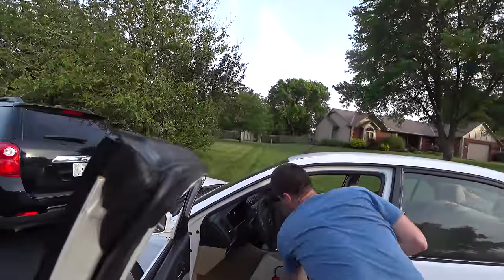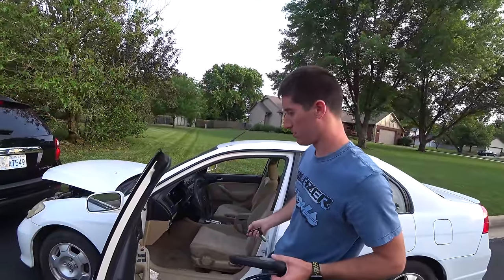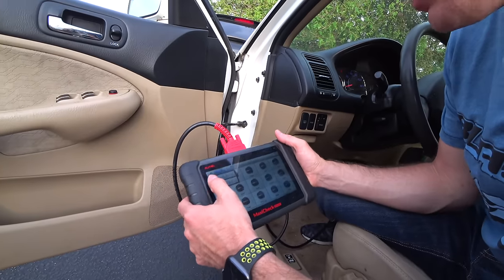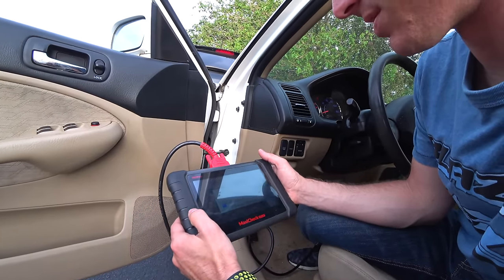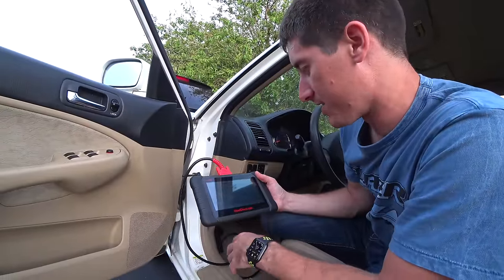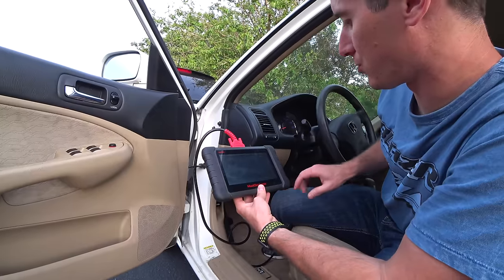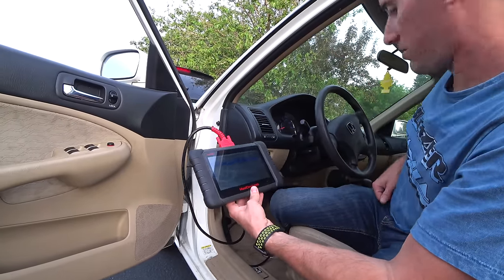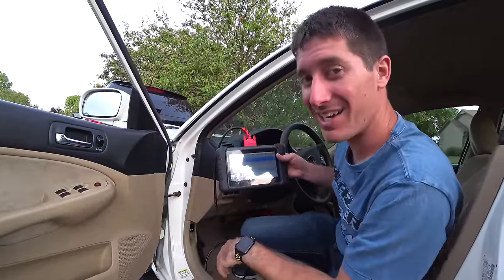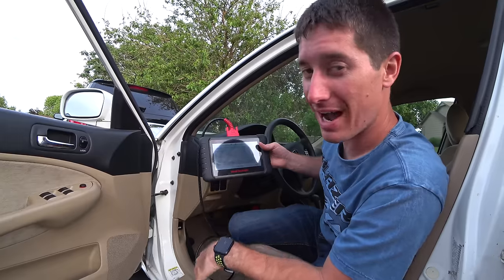Got some keys. Came with a quick trip card and a bottle opener and a remote that may or may not work. It appears it may not. See if auto VIN scan will get it done so I don't have to do any work. This is a 04, so it should work. Okay. Load the Honda diagnostics. 2004 Civic Hybrid, yes. Testing, shift to park or neutral, okay. We are in park and it is scanning. It is finished scanning and we have 9 engine faults and let's see, 5 faults from the hybrid system.